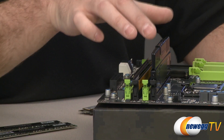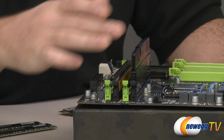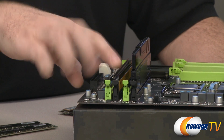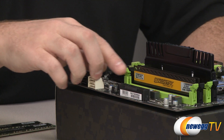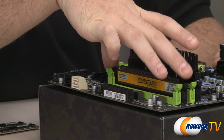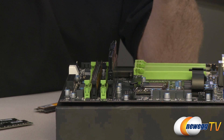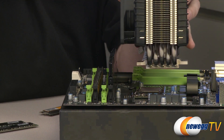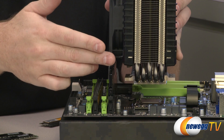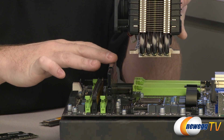Here's a quick demonstration and comparison. We have a more traditional DDR3 DIMM with a raised heat spreader to provide extra heat dissipation, but as you can see, the height of this DIMM is pretty substantial. Next to it, I've installed the Tactical LP, and you can see that it barely reaches above the level of the actual DIMM slot. A reason why you might not want to go with a higher heat spreader DIMM is if you have a larger heat sink, such as the Thermaltake Frio right here — especially if you want a push-pull configuration with a fan there. With the taller memory, I would not have enough room to have the memory stick with the heat spreader and have my push fan attached and installed in place.